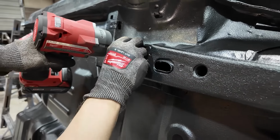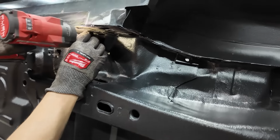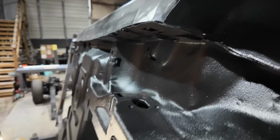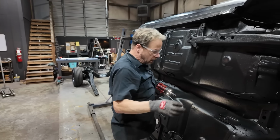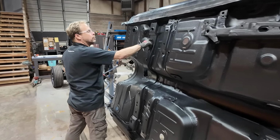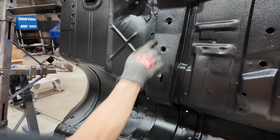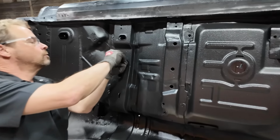That was chase. Did pretty good. That works. Righty-tighty, Kevin. So in theory, those spring pockets should just go right in and the bolts should just glide like Zeus has his hands on them. So what we're also gonna do is, this is the hardware for the back side, for the rearmost portion of our subframe. So I'm gonna chase those threads also.